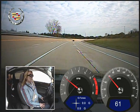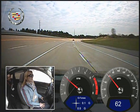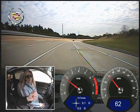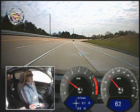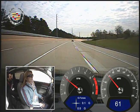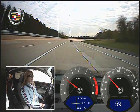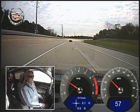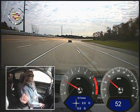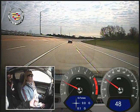The next thing we're going to show is a maneuver. WD, come back to 50 and stay in this lane. When I tell him to, he's going to slow down to 30 and go in the adjacent lane. You are going to grab the wheel and follow him with the steering — don't do the brakes or the throttle, just steer behind him and follow him as he slows down. This is just to show how quickly it lets the driver take over and what an override looks like or feels like. So WD, go ahead and slow down to 30 and go in the adjacent lane.